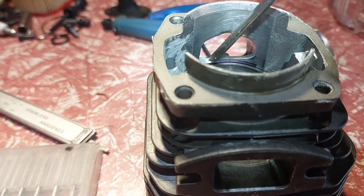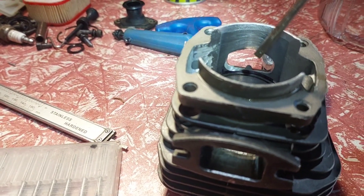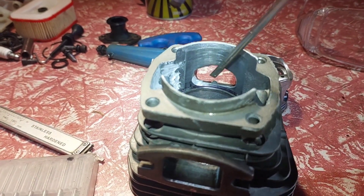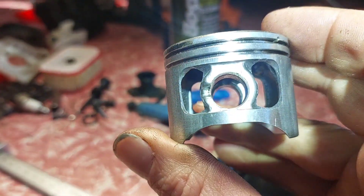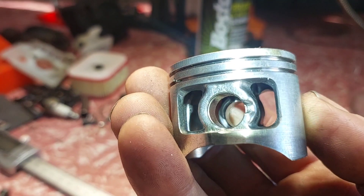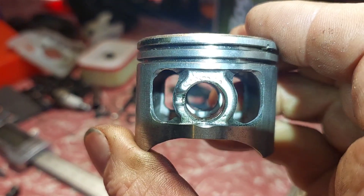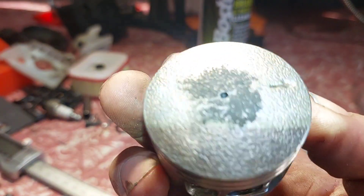The intake 'Mickey Mouse' ports — that's what they look like. I haven't finished yet but the piston sits at the top there — there's more material to be removed. The black marker indicates where the piston sits normally, so that shows one side. See how much it's opened up: the window on the right faces the exhaust and the one on the left also faces the exhaust side but it's bigger. The back one has been opened up a bit — don't need much more there as it's already got heaps of airflow.